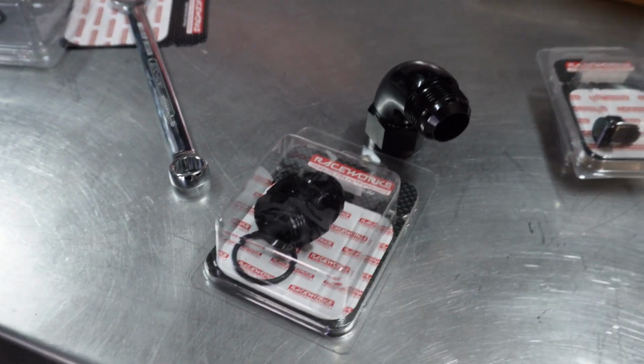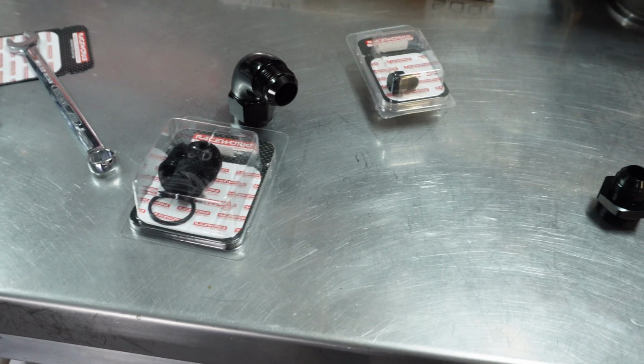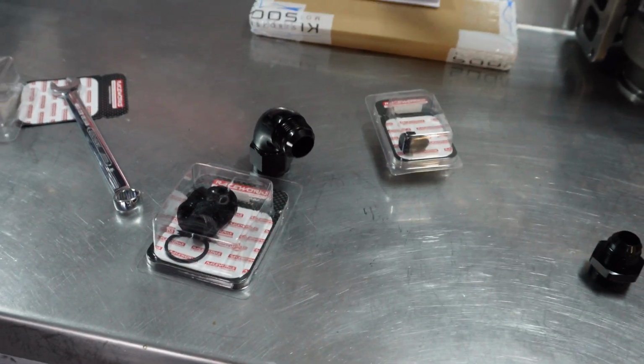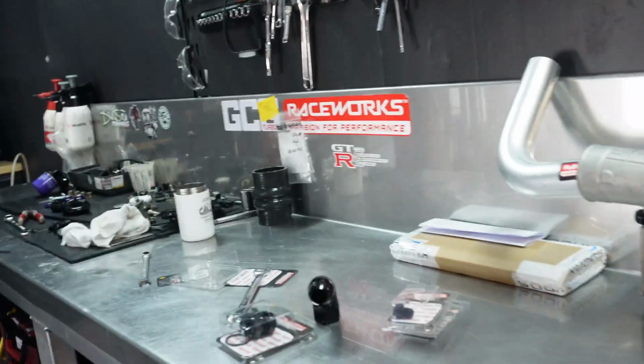And Dartone Racing, Anthony is going to fabricate me up a catch can, and we're going to run 2 catch cans. I'm going to run one for the valve covers, and then one as a crankcase breather. So I think just good crankcase ventilation on an RB26 is very important. So there's nothing wrong with running 2 catch cans. I want to run 2 catch cans because I don't like the idea of running the oil back to the sump. It's messy, especially on E85. So we'll see how we go. We might have to change it.